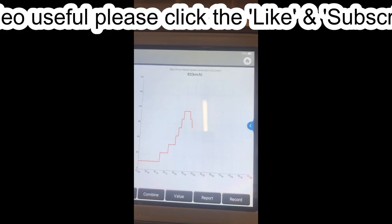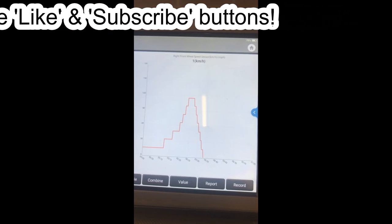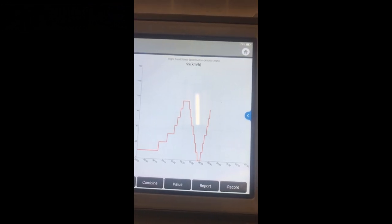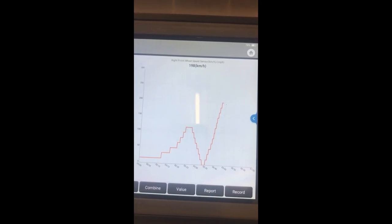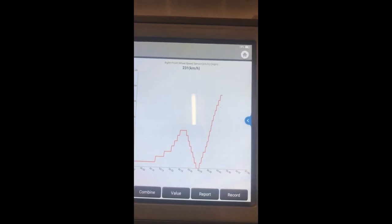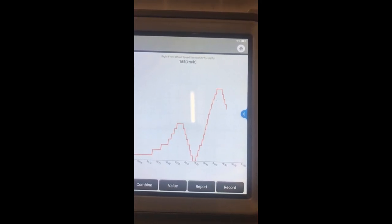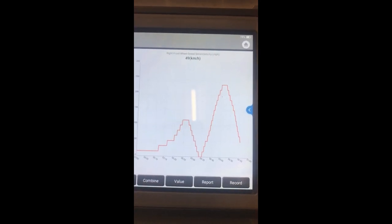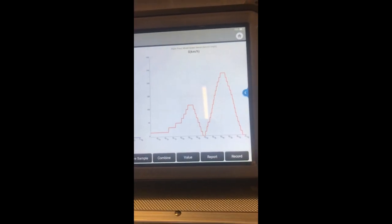For some reason the ABS pump is generating the signal perfectly, but when I go down the road and I get to 20 kilometers an hour, it flatlines, it skitters about, and it goes up to 255 kilometers and puts the fault light on. And I can see just from doing this, the wiring on the signal side is pucker. What do I do next?